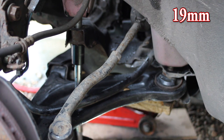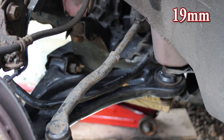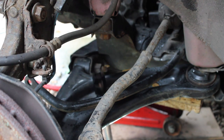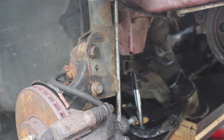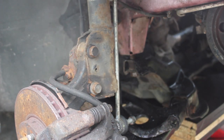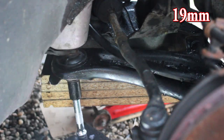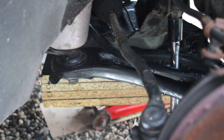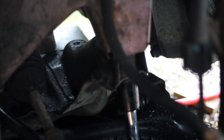To start with I sort of loosely get all the bolts in on both sides, just want to make sure it's nicely lined up, and then I tighten them. Once it is all back together and once you've test driven it, it's worth going back over these to make sure they're all properly tightened up whilst the suspension has had a chance to settle and move around. We've got the four main bolts - two either side - that hold the subframe in.